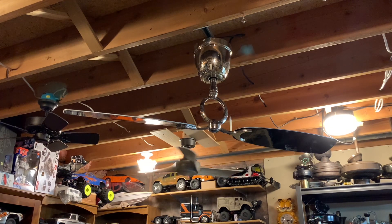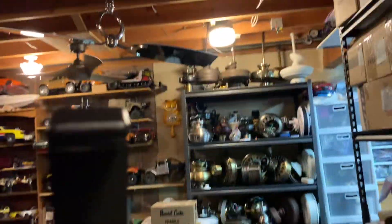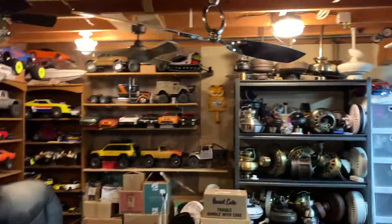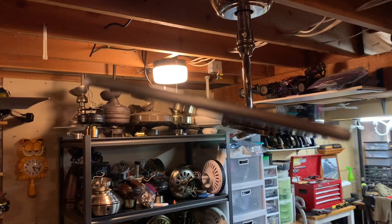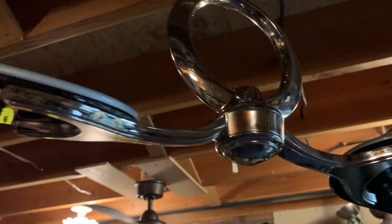We'll be going into some technical info in a second, but first I'll give you a close-up of the fan. This one's in the polished chrome finish with silver or black gloss blades. I have black facing down because I thought that would look better. The fan has a 15-degree blade pitch, which is definitely not bad. But of course, for a two-blade fan, you usually see a bit of a higher blade pitch so you can move more air. And this fan does actually move really good air.